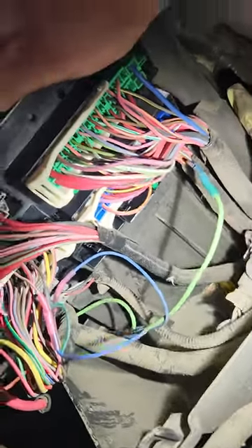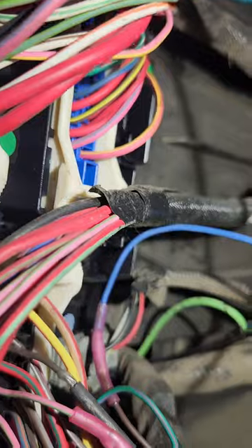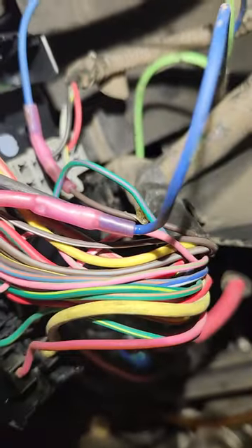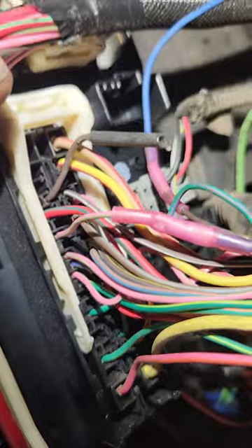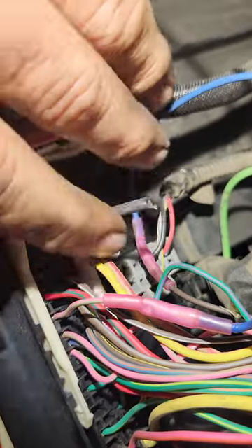I had to go in here and figure out the wiring. This blue and orange is the fuel pump wire, and that is in the blue connector. You go into this black connector and it is pin 25 right here. I've got heat shrink on the wire, but that's the trigger wire from the ECM. So you just cut that.